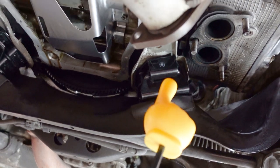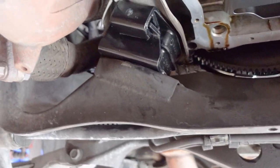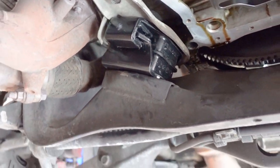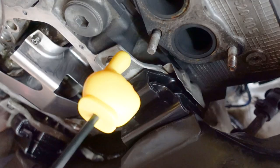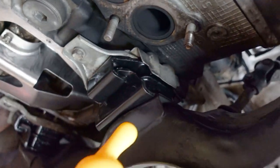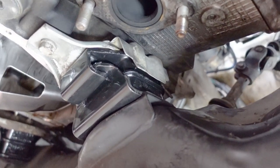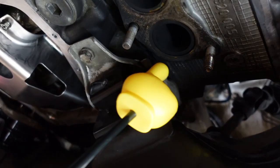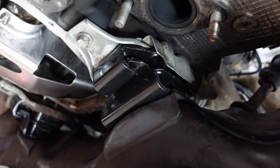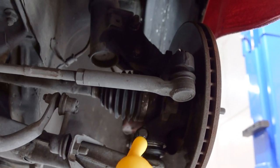All right, so my favorite part, let's check out the underside. STi N1 engine mounts. We just installed these guys, replacing those worn out engine mounts this had. I actually kept the original, I guess you would call these engine mount brackets, because if we see here, they actually have these welded in heat shields to protect the engine mounts from the exhaust. So the ones that came with these N1 mounts did not have this heat shield. So I thought this was a way better alternative to keep the stock ones. Yeah, just fixing some safety issues.